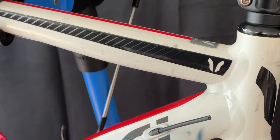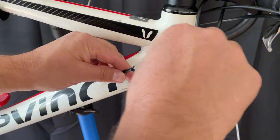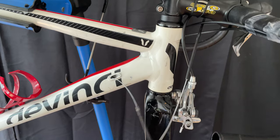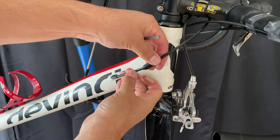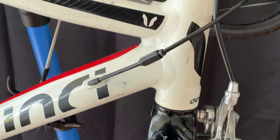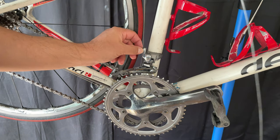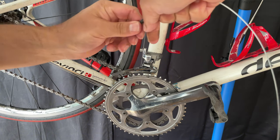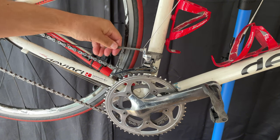Here's my new way of greasing the cable — I just shove it into my squeeze bottle of grease and feed the cable in. The barrel adjuster just fits right onto the housing; it basically has ferrules included. I've improved this bike because you can now adjust the front shifting properly. I don't know why any bike manufacturer would make a bike without barrel adjusters on the frame. It was probably designed for the older 5600 series where the cable stuck out.